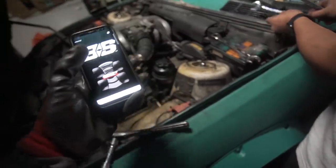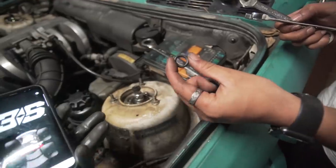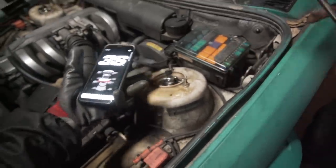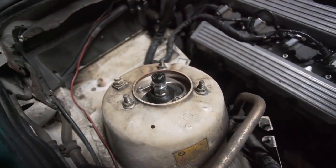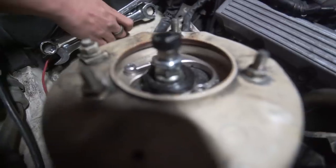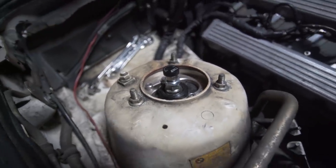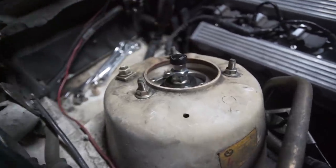And then we noticed that the fronts were leaking, and that was because we were missing this O-ring. It comes with the OCD kit. It goes under all of these stacks of nuts. As you can see right here, this is the front right one. We haven't fixed it yet, but once I air it up, you can kind of hear a leak. And so that's what we just went on and fixed. So we're gonna remove this one and add that O-ring.